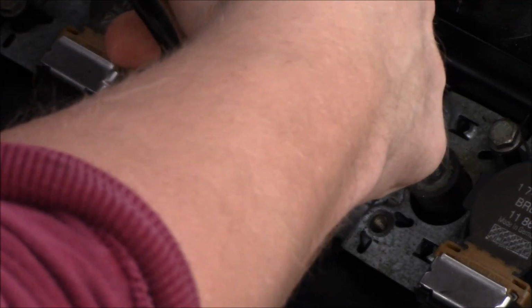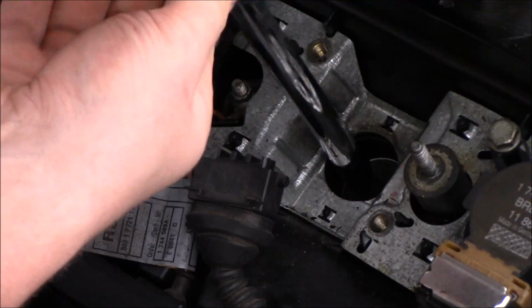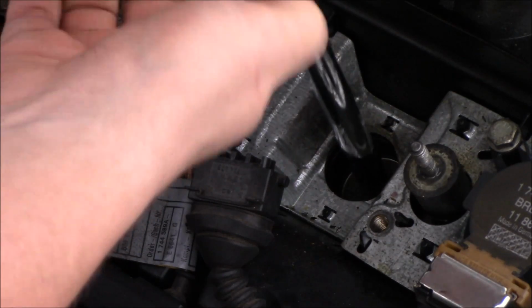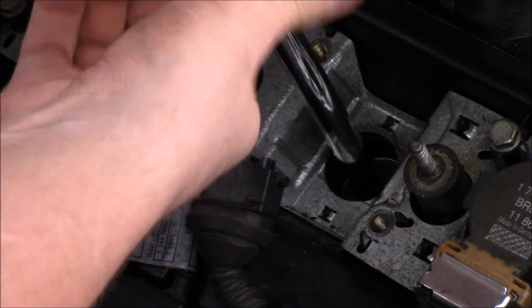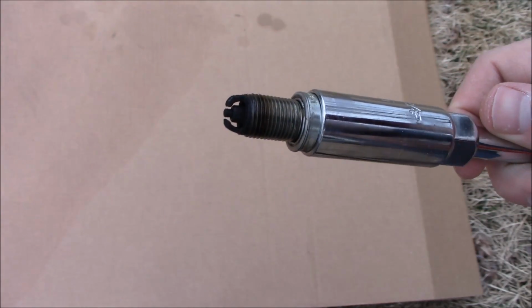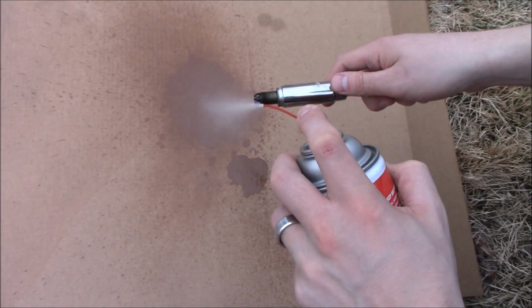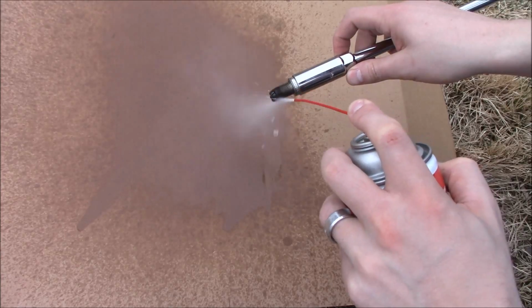Your air filter is probably clogged, or your mass airflow sensor might not be reading the airflow correctly. And a fuel-lean mixture could probably mean that you have a leak somewhere in your air intake. It could be anywhere between your mass airflow sensor and the end of your air intake manifold. Just check all the boots on the air intake, check all the gaskets, check all the seals, check your idle air control system. I'm going to come out with a series of videos that shows different things that I checked and replaced just to be sure that my air intake was getting the proper airflow.